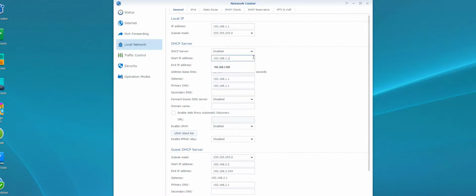I am going to change this because I like things to be a little bit more organized, to 100 IPs within the range of 192.168.1.100 to 192.168.1.200. Yeah, within the range of 100 to 200. So the switch thing that I was telling you about earlier on, we've got 100 devices, and we are going to hand those 100 devices out to whomever needs them.